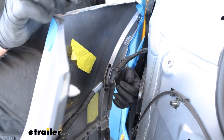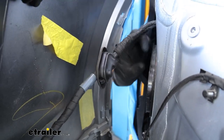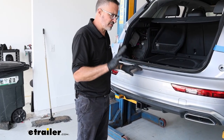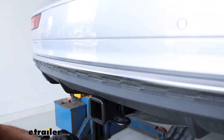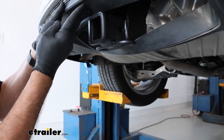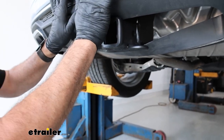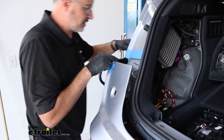When reinstalling the fascia, pay particularly close attention to the driver's side — mainly the grommet on the wiring loom. It needs to be reinstalled back onto the body to seal out any gases from the rear end. We stopped installing the fascia to show you something on the bottom: the back panel needs to thread under the hitch, while the outer edge toward the bumper goes above the hitch. As we continue installing the fascia, it will slip back and go behind the hitch. This is a great time to make sure everything's lining up and to reattach the grommet on the driver's side.